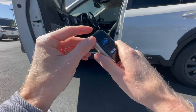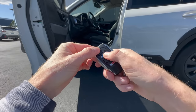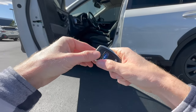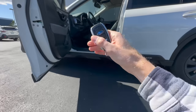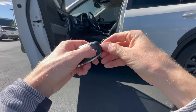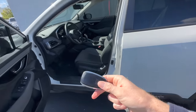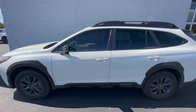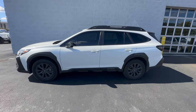To lock your key fob inside the car, put it into sleep mode: click and hold the lock button at the top while simultaneously double-clicking the unlock button (star cluster logo). You'll see the red light indicator flash a few times, confirming it's no longer active. The key won't lock or unlock the door in sleep mode. As a safety measure when testing this, take the key shank out so you can still get back in. Then lock the car — you can use the MySubaru app to unlock it when you return.